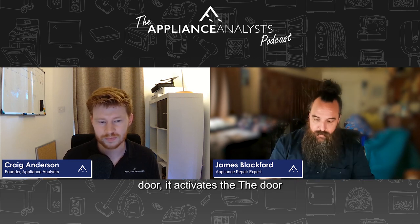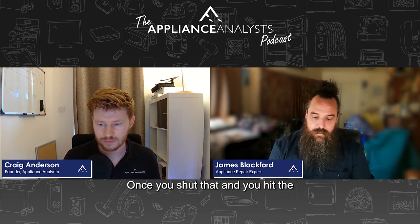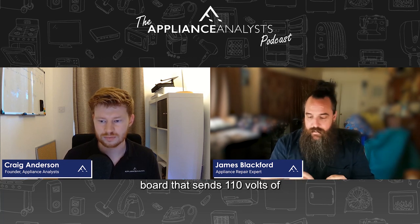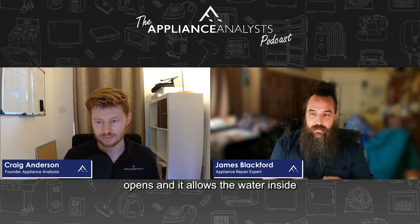when you shut the door, it activates the door latch, door lock, door switch. They're all kind of called the same thing. Once you shut that and you hit the start button, you have a control board that sends 110 volts of electricity to a water valve. When that happens, that water valve opens and it allows the water inside the dishwasher.